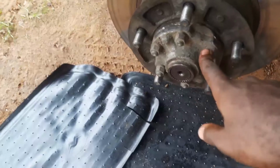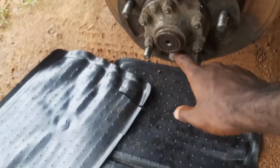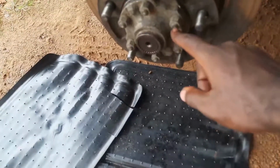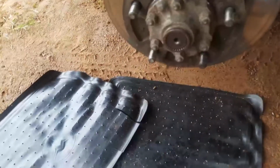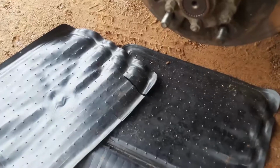So great, awesome. But next thing we're taking off is the flange. Take out all these I think 14mm nuts, and we will just keep them on the end here, and then we're supposed to get a brass stick looking thingy and a brass hammer and just knock the nuts so that the cone washers all come out, and hit the sides a little. But I'll see what I can find, because of course I don't have brass tools. I mean, I'm literally doing this at home, right?